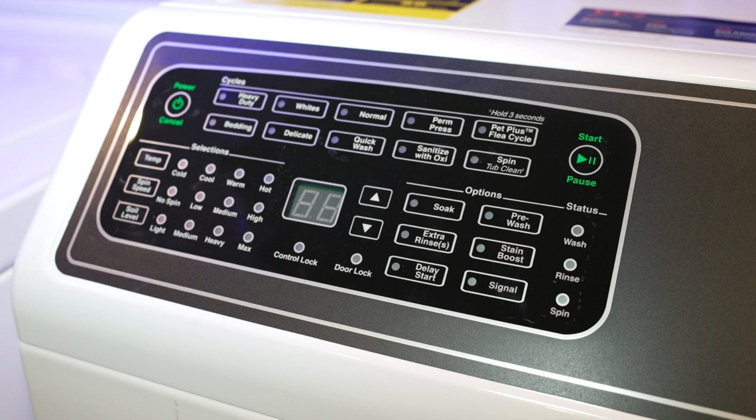There are going to be 5 settings that you can choose from: 00, 05, 10, 15, and 20. What that actually stands for is the inches of water that you're going to add to the machine during each wash, with 20 really meaning 2.0 inches of water in the machine, for example. If you go past 20 or 2.0, it's going to just recycle to 00.